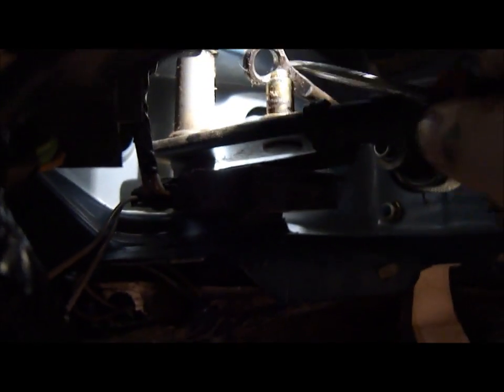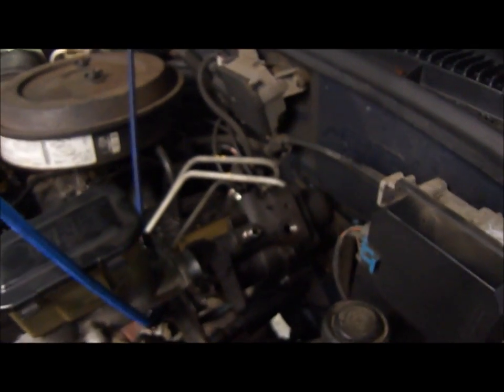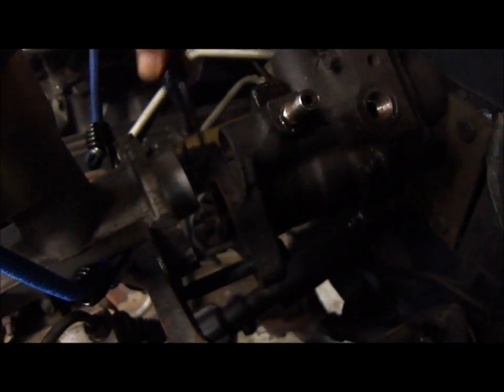So before I remove the last 2 nuts, I'm gonna take out this foam washer thing again. Try to remove this connection here, the rod off the brake pedal. Hopefully you can see that. I'm trying to pry it off with a screwdriver. There we go. Since I'm working by myself here, and the hydro boost is about to be completely unscrewed, I'm gonna use another bungee cord and secure it to something so it doesn't just fall out once I remove the last nut, because this thing is actually heavier than you would think. I don't want it falling down on those brake lines and stuff like that.